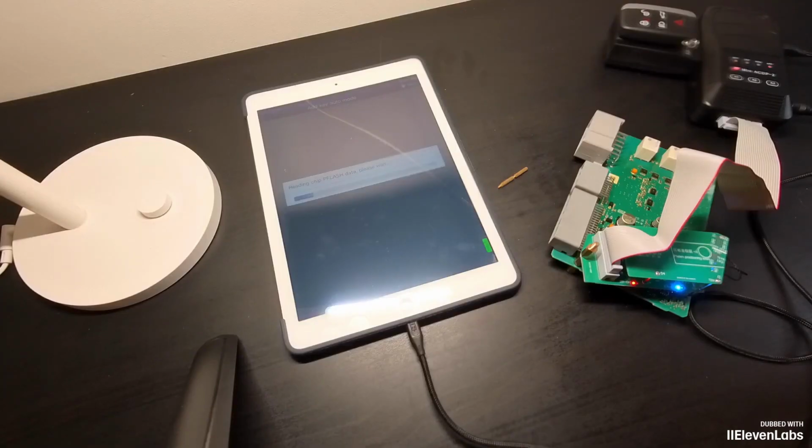By the way, my recommendation is to initially set up the tablet, phone or computer in such a way that at the moment of this procedure, it does not go into sleep mode. For example, there might be a call to you, or it might not finish the process. Because if at this stage the tablet shuts down, or someone calls you, or the battery dies, or even the internet disconnects, then you will have to order a block and will encounter completely different problems. Instead of a key, you will have to do much more or contact other specialists.